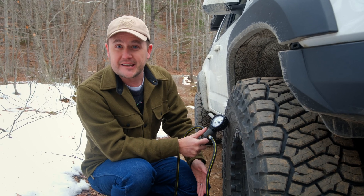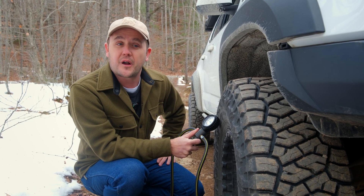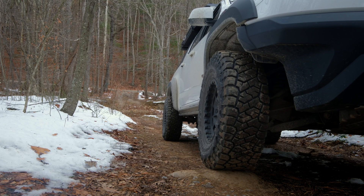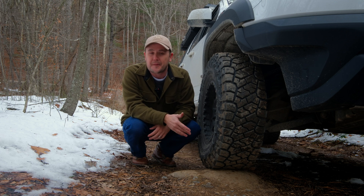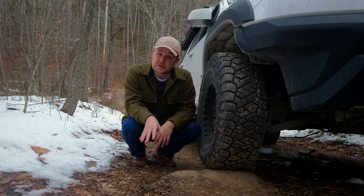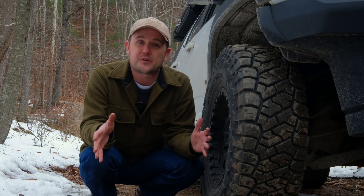We're actually going to stop here at about 17 PSI because it's pretty impressive how much the tire has bulbed out on the sidewall. We'll hit this rock one more time for visual representation. At 17 PSI, it's actually really funny — on the other two tire pressures I could actually feel this rock, but this time I couldn't feel it at all, so it was way harder to gauge. Again, total overkill for this trail, but this was a great chance to show how much it deforms the tire at low PSI, helping to increase your footprint. At 17 PSI, it still wasn't very clear on camera. Luckily, Rick has a great idea that I think is going to help.